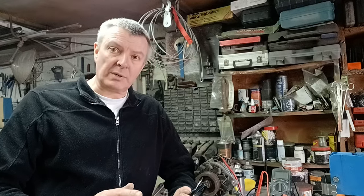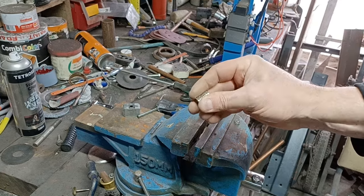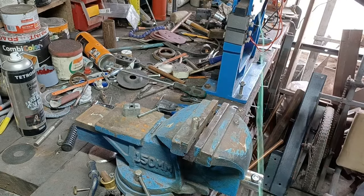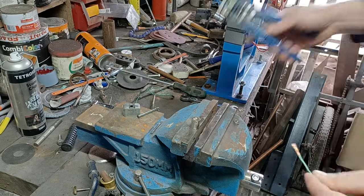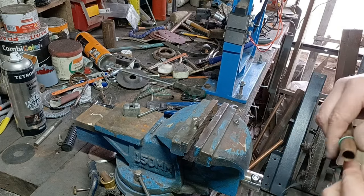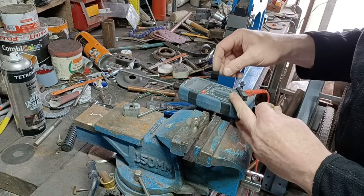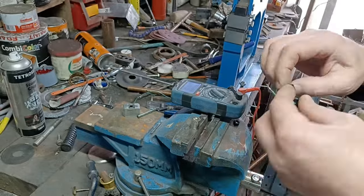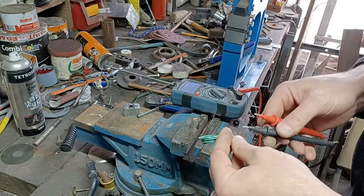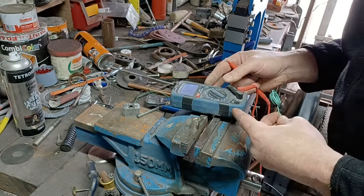It's quite fascinating how alternators work — a little electromagnetism. The principle is quite simple: you get a magnet and a coil of wire, pass one over the other, and it sets up an electrical charge. I might have a little try at that now. I have my rare earth magnets and some wire — let's experiment. I guess this would be an AC current that would be coming off of this. I need something to coil my wire around. Multimeter set to AC. Right, so if you hold one probe on there and one on there...